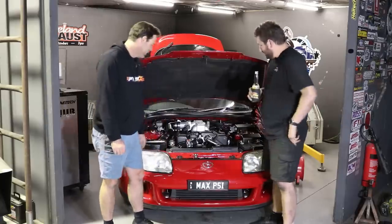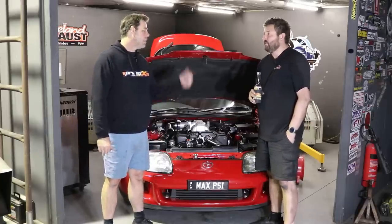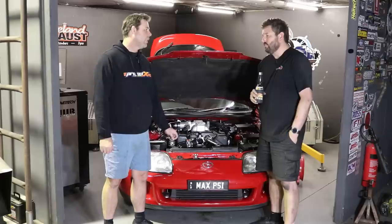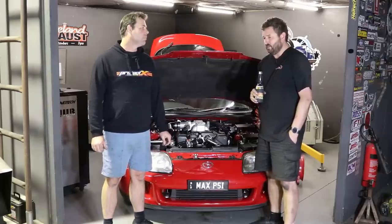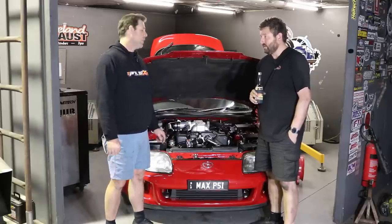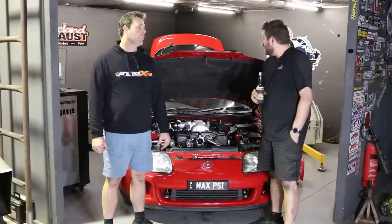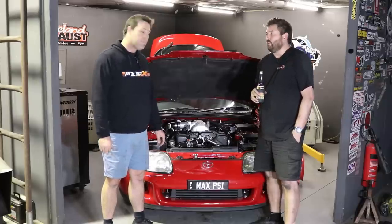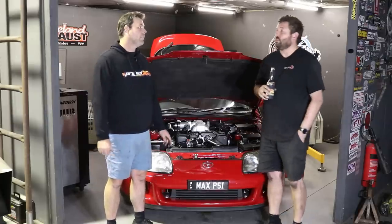I changed out all the cooling pressure sensors with those Bosch ones, and they all work. And the coolant pressure was perfect. The other one you were looking at, the fan one: I accidentally switched the don't-turn-the-fan-on-when-the-engine's-not-running setting, so I was trying to cool the trans down with a fan that wasn't going. That seems to be the only problem this thing's having. The transmission gets fairly hot, fairly easy, which is Powerglide stuff, but once it's moving through the air, it'll be fine.